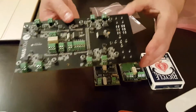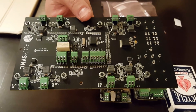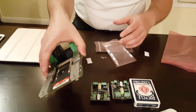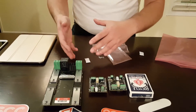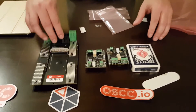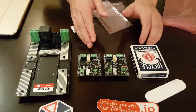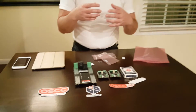Once we connect this to the car, there is an electrical mini-computer network inside the car, and we need this board to connect to that system. Then from there, once we hook up this board to it, we can hook it up to a computer and load our software in. That way we're able to control the car's brake. The same thing applies to these two boards — once connected, we can control the steering and throttle.